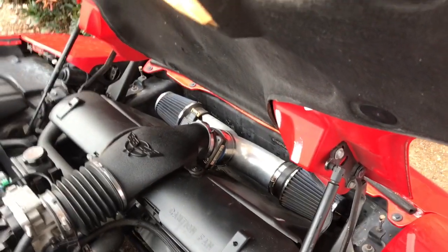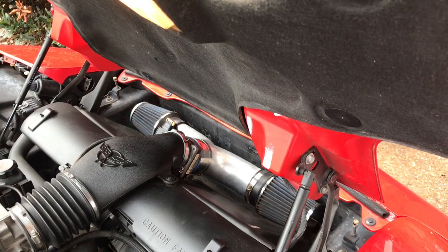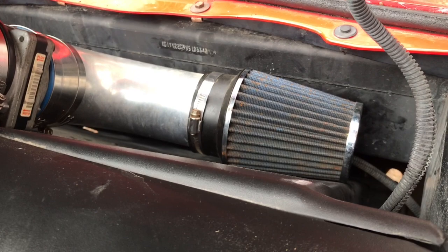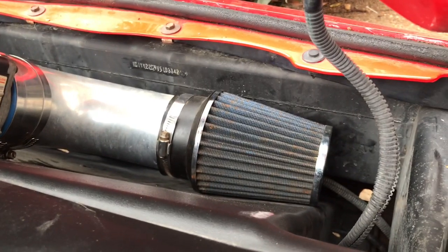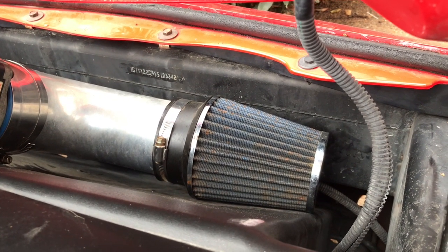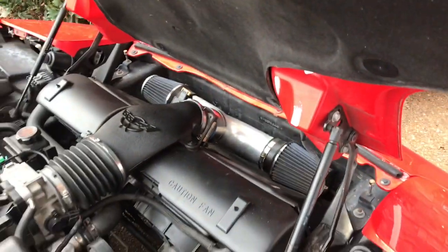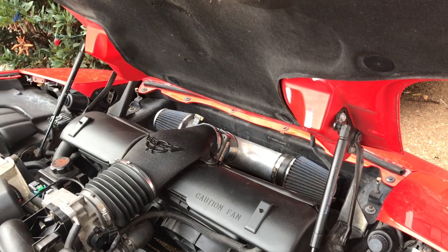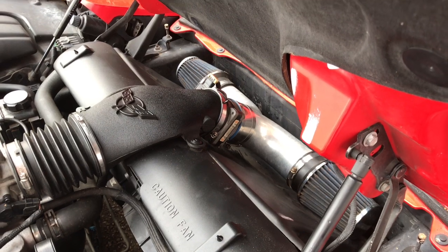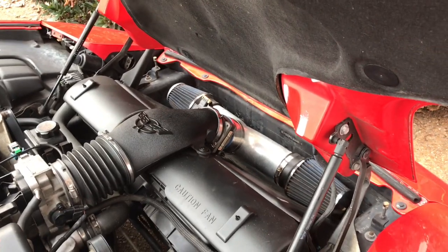I'm not feeling great about this modification that came on the car. I feel like perhaps it's just trouble waiting to happen. The filters are a little rusty, where the metal that holds the pleated material is. I tried to buy some new filters for it, and they're such an odd size that you can't get a really good name brand filter to fit on that without it sticking up too far or putting weird pressure on the mass airflow connection. So I have decided to swap back to stock with the zip tie mod and see what happens.